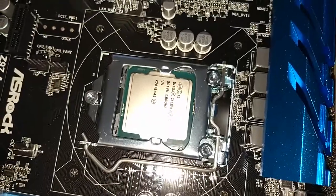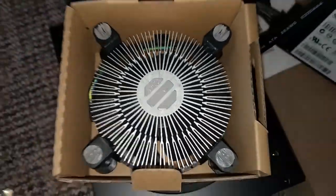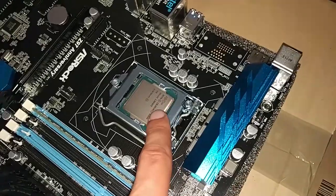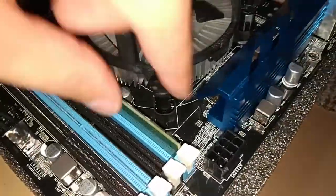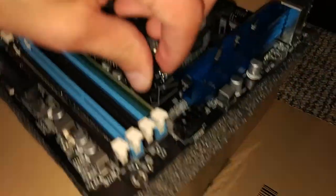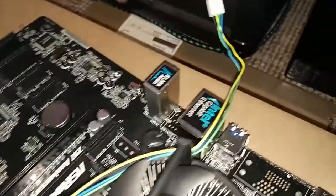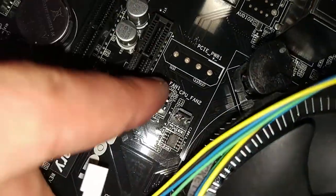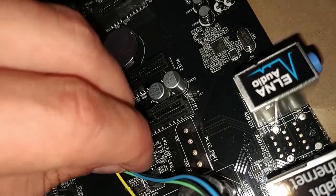Put back down this little thing and apply a little bit of pressure — that should be fine. Don't forget the fan, your cooler for the processor, but don't touch the coolant, the little fluid in the middle of it — don't do it, it's a waste and it's necessary to efficiently cool your processor. Tighten it up; there are little screws on the side which you turn about 90 degrees. Also don't forget your CPU fan — plug it into the motherboard at the CPU fan one, it's a four-pin connector.